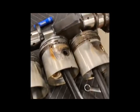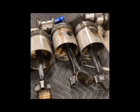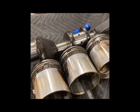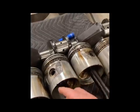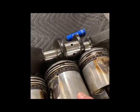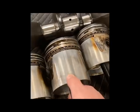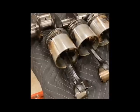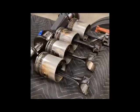The crank looks great — they're not going to have to do anything to that. The pistons are probably fine and will get new rings at minimum, but honestly it may be cheaper just to get a rebuild kit and have everything I need and put it all in. I did notice — and I don't know if this makes a difference — but the notch on number two cylinder was facing forward while all the other notches were facing backward. Typically you've got some sort of arrow on top of the piston, but there's no clear indication I can see right now. When I clean up the carbon deposits it may be a different story, so I need to figure that out and get it back in properly when we rebuild.